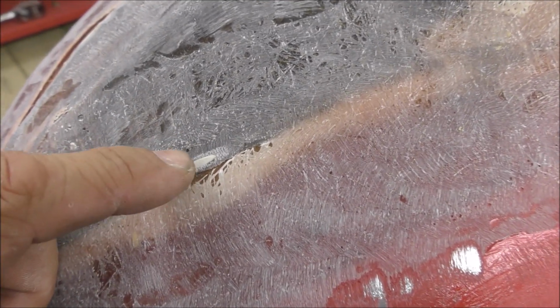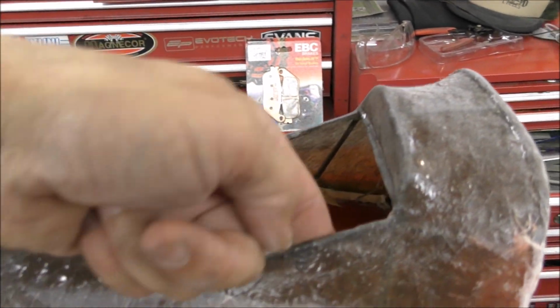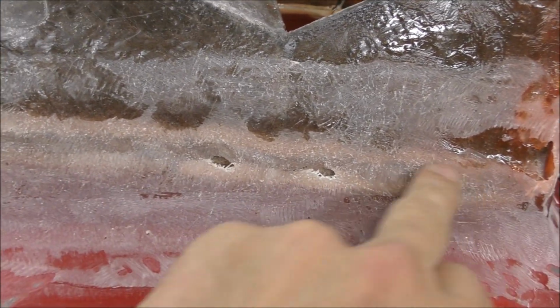And obviously what it's done is highlight, where are we? Here. Highlight the little high spots, so that will get filled. Not with filler, I'm just going to re-fiberglass this now. There's no fiberglass on this top bit yet, here, but I've just blended these in. There's the rope underneath there, soaked in resin and rock solid. Gone in there with the sander.